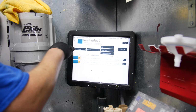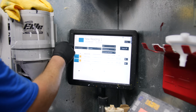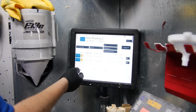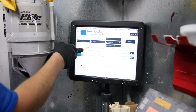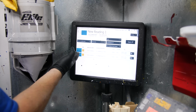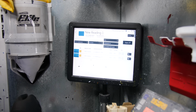So we've got the sample that we took of the paint from the camera loaded into our system. We insert that we're painting at paint code CI, so it's going to compare itself to the 2 variants for CI. This is your MR, your match rating. It's out of 100. So this being a match rating of 12, and this a match rating of 17. So the red's close, but it's not quite as close, and it does just confirm that Prime is the mixture that we're going to use.